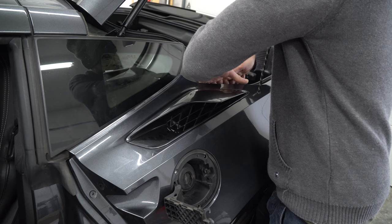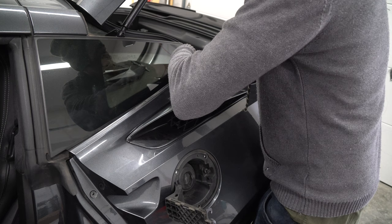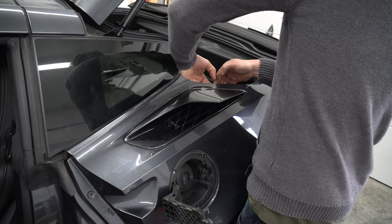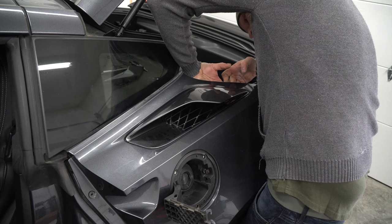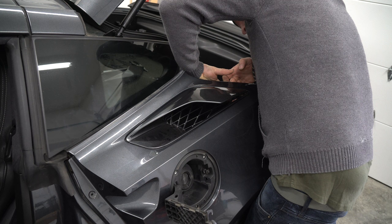Leave it separated up a little bit, get it over there, and get it onto the spot. Being extremely careful — it may be hard to see on camera, but all you're going to do is: this hand has the nut, this hand's holding up the fender. Bring it in. It might take you a few tries, but once you've got it, you've got it. There we go — now you can get your 8mm and tighten it.